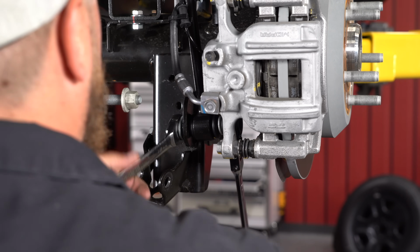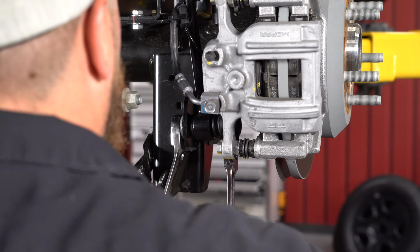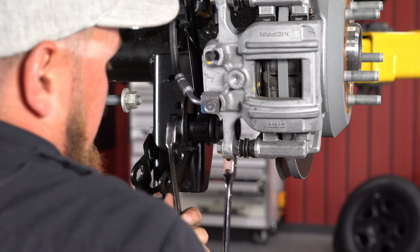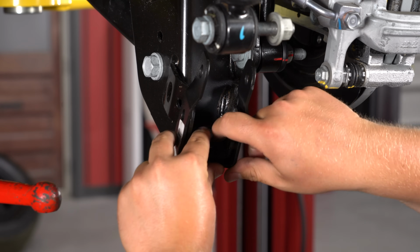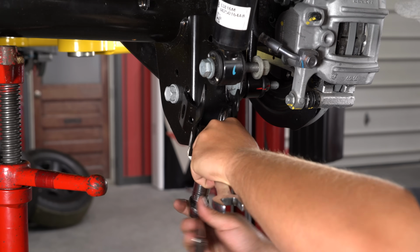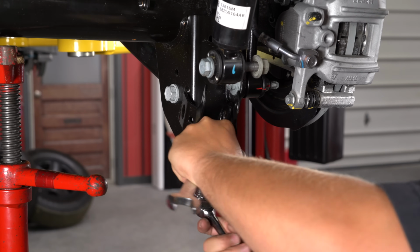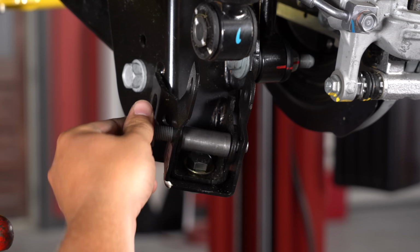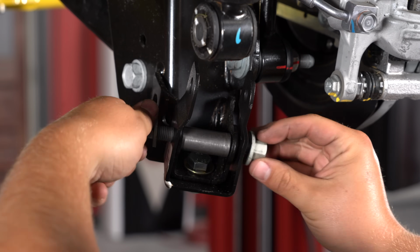Tighten the lower bolt using an 18mm ratchet wrench and an 18mm socket, or 2 ratchet wrenches like we have here. Place the lower shock extension bracket over the original post. Then install the provided hardware down through. Use the factory shock bolt to go through this lower part with the sleeve installed. Now don't tighten anything down, just like the front, until you've got it all installed.